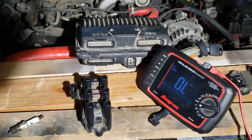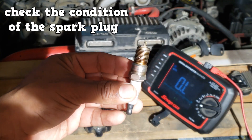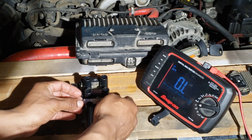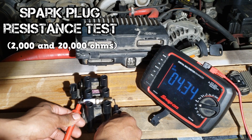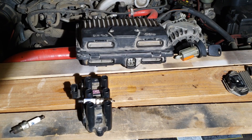If there's adequate spark but still misfiring, remove and check the condition of the spark plug. If it looks good, you can check its resistance. The specification for this particular spark plug is between 2,000 and 20,000 ohms. If this does not fix the misfire, then it is most likely not ignition system related.